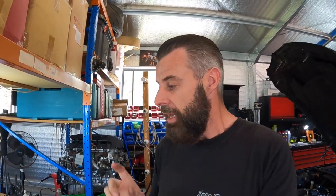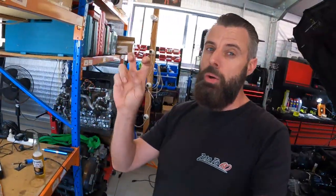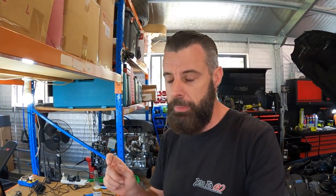Welcome to another episode of Zero to Sixty. We're going to try and actually get a key coded to the E92 M3 that BIMtool wouldn't do last week. There is an issue with CAS3 Plus and CAS3++ ISTA-P CAS modules where you basically can't code a key through the OBD port. The BIMtool is supposed to downgrade the software and it's supposed to be safe. However, I failed on two ISTA-P CAS modules last week. Luckily it didn't brick them — well, not fully. I was able to recover them through OBD.